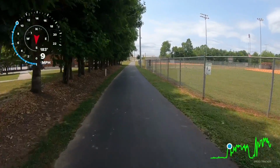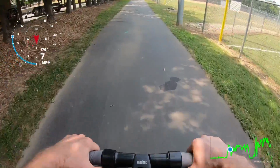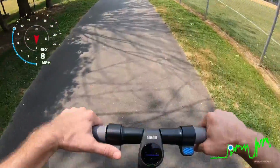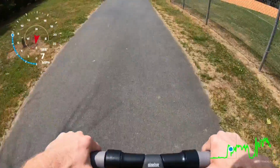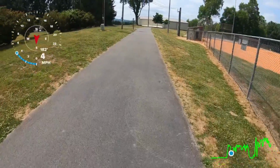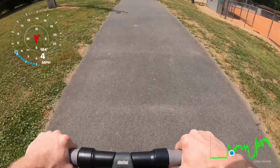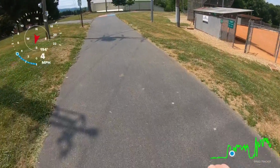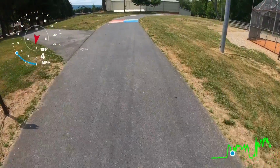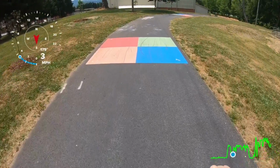Now, when I did my firmware update, there was a change. There used to be a setting for the brake, so it was low, medium, and high braking, and you could set it. That setting is gone now, so when you want to brake, just ease into this thing lightly, because this thing can brake. It will stop you. What they replaced it with is a coaster setting, an energy recover setting, and that's actually on the throttle. So what's going to happen is, when you let go of the throttle, the coasting will do some energy recovery, but that has the effect of braking. So I set that on low.